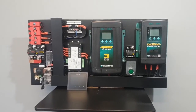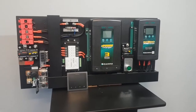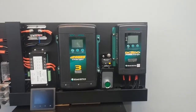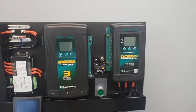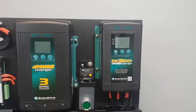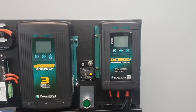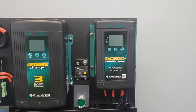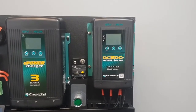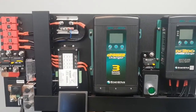This is Enerdrive's Board G, suitable for all lead-acid battery types as well as lithium batteries, including the BTEC lithium range. It comprises the Enerdrive DC to DC charger, suitable for both vehicle input charging and solar. This unit prioritizes your vehicle when traveling and when stationary works as your solar controller — a particularly good MPPT solar controller, suitable for receiving numerous solar panel types up to 45 volts input and up to 800 watts of solar charging on a 12-volt system.